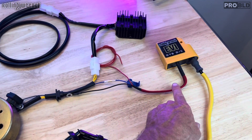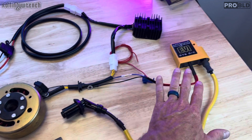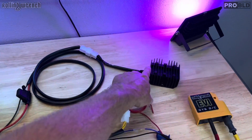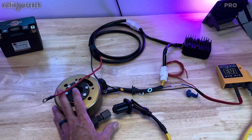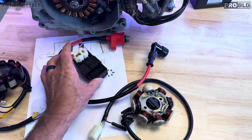This will tell the engine when to spark every time it spins around. So this is the complete kit — everything you need to convert your GY6 QMJ157 from 8 or 11 pole to 18 pole. Maximum charging — this is as big as you can go on a GY6. And you're upgrading the CDI coil combo: this is a microprocessor CDI, the spark is much better, timing is advanced, and it's made in Taiwan. The rectifier regulator is also included, and this bypasses all of your old charging and ignition system.